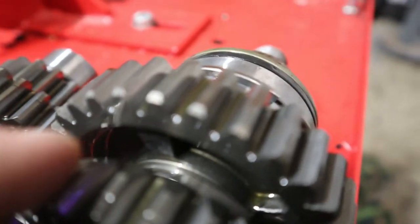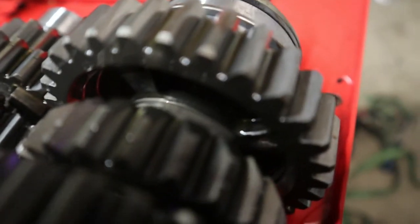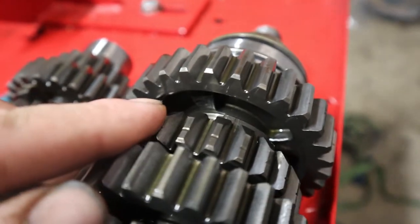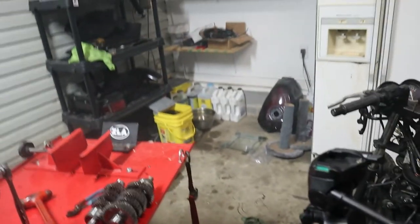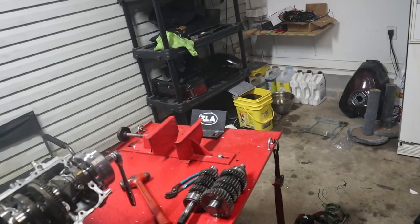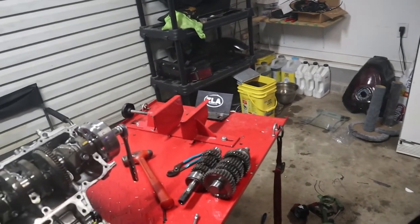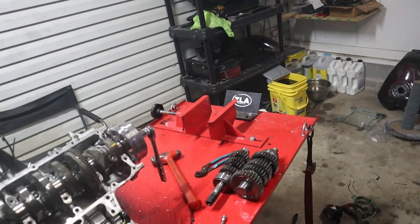And the second gear, you can kind of see where it's been skipping. Where's the little ringy? Autofocus is not liking it. So this needs back cut, this needs back cut. I'm gonna inspect that other shaft quick and make sure it doesn't look that way. If it does, we're gonna abandon the weekend and we'll just send this one off, get it cut, and be done. If it isn't, it's going in.